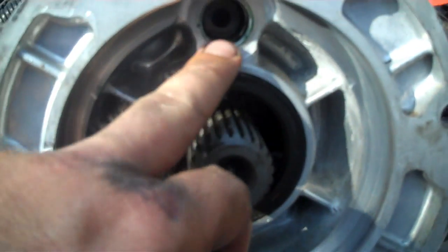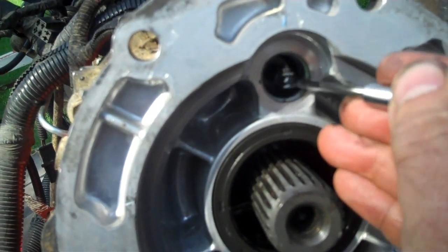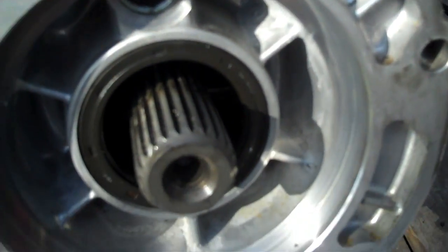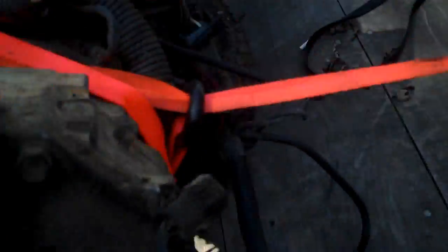And here's the little plug you get once you get it out — the hole up inside there. That rod that you're shifting here, that rod's got to come out. Let's see if we get lucky enough to use a magnet and pull it out. Just tug it a little bit and out it comes. Don't always expect it to be that easy. Now pay attention — a little word of advice I just learned. When you pull these transmissions out, before you pull that rod out, even before you pull the shifter off, put your transmission in neutral. I'm about to show you why.